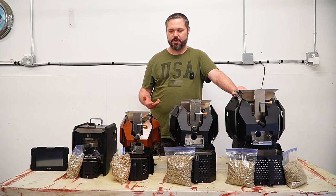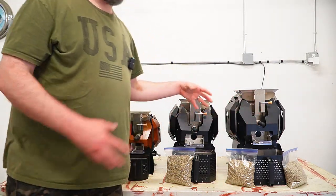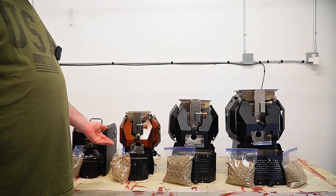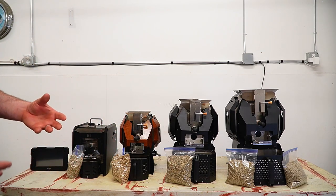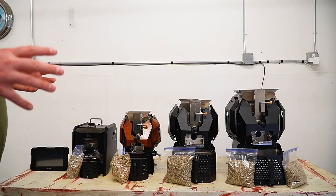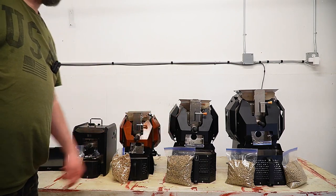You do need to do some cleaning — we have a cleaning video. They're fairly easy to clean on all of these. There's a heat shield you remove, then the face comes off and the drum pulls completely out. I did a cleaning on the M2 in about 10 minutes. It comes with supplied tools and Allen keys. These are all stainless steel construction, so you can put the drum into a water bath with coffee cleaning solution and scrub the oils off. I typically just use a brush on the inside. Make sure it's really dry before putting it back together — it takes about 10 to 15 minutes, and if you're a hobbyist you might need to do it a few times a year.